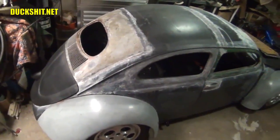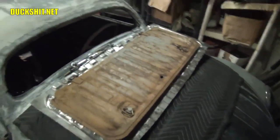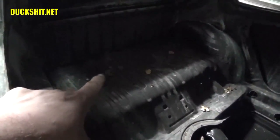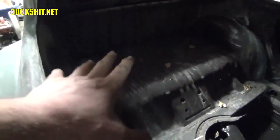For those who don't know, Eleanor is my 1956 Beetle that was taken by a hurricane and completely destroyed. I rebuilt it. What I'm about to do is install a hatch from a 1973 to 1979 Volkswagen bus right here in the rear package area. The reason is that it gives me wonderful access to the clutch cable, starter bolts, CV joints, transmission fluid fill, throttle cable — all accessible through this hole. I can even change out the starter. That makes all the difference working on this car — no need to jack it up or pull the wheels off.